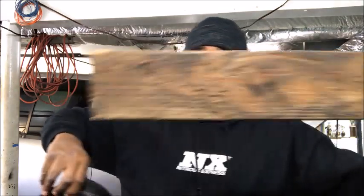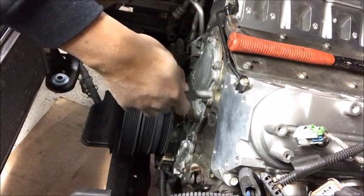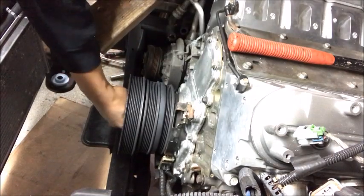So I'm going to bring it back old school. I'm going to get this piece of wood, put it on the face of the harmonic balancer, and bang it on to the point where I can get maybe nine turns of the crank bolt. That way I can install the balancer without any issues. Now I know what you guys are thinking — that's not the proper way to install it, you may damage something or strip the bolts. But what you've got to remember is the bottom half of a stock LS engine is capable of holding 1200 horsepower — stock. So the chances of you damaging that crank by hitting the harmonic balancer as it slides on is pretty slim. The objective is to hit it enough so we can screw the bolt in at least eight times and then torque it down.